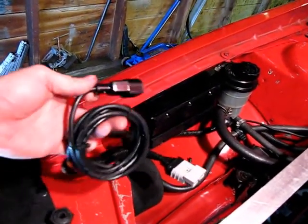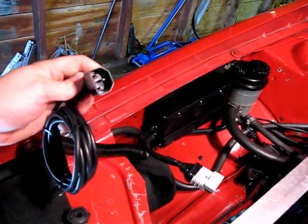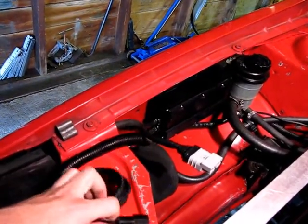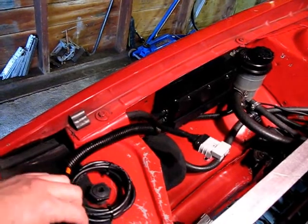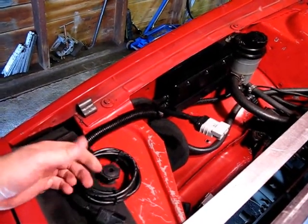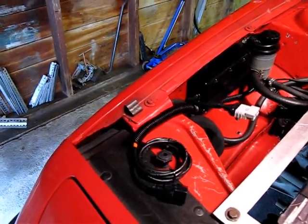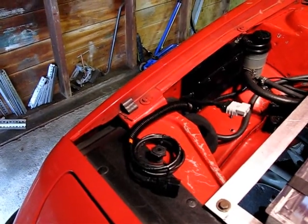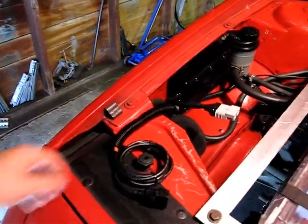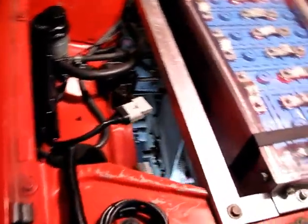On the high voltage side, I ended up using one of these monitor power cables, very similar to how I did in the past, which just makes it easy to plug it in and unplug it. This is probably rated for 15 amps or something coming out of the wall, and we're going to be pulling a few amps through it, up to like 4 or something at 200 volts. So no big deal. It's definitely more than adequate to handle the load.